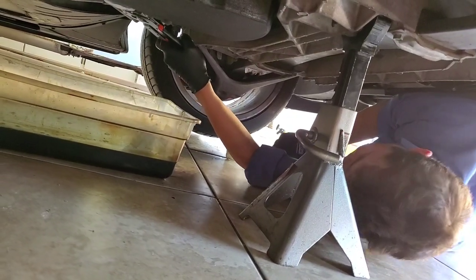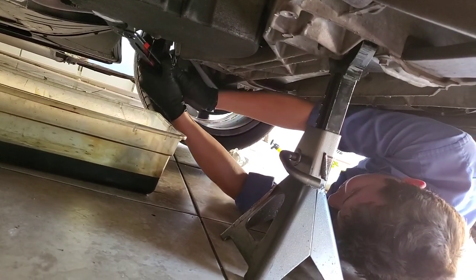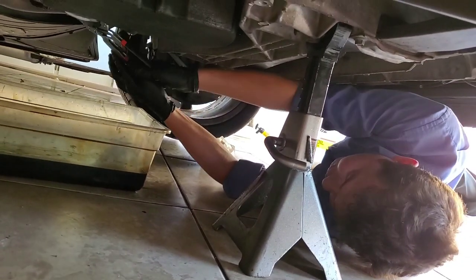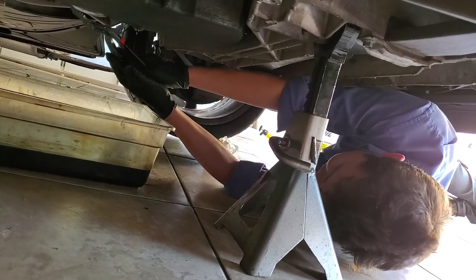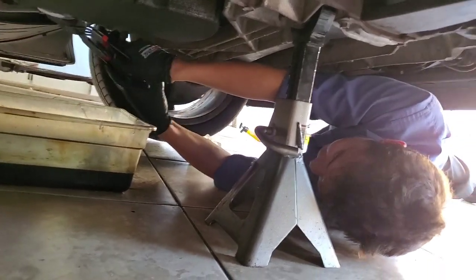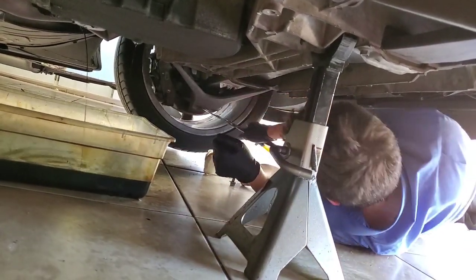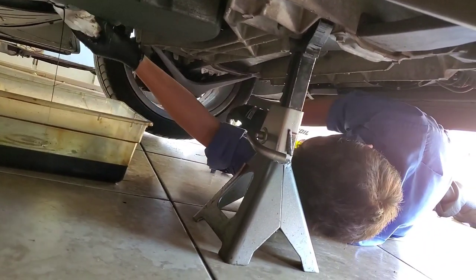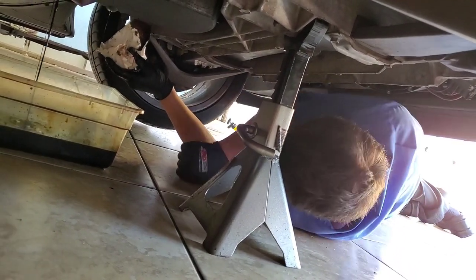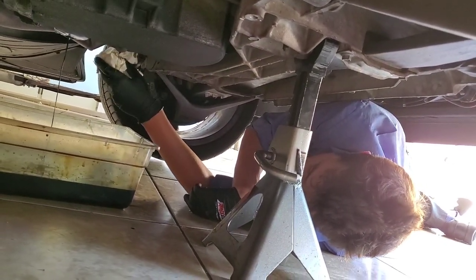She's a little bit of a stickler. There she is — this one's going to be like a little half turn. I wanted to thank a subscriber who said you can always drain the oil filters — get a little punch. I think this filter is so thin it already punched just with the wrench. Next time I've got to try that — put a little punch on it. Nice and loosey goosey. Now let her drain a little — you always want to use a little towel. It comes out quick. Just let her drain for a minute, and then the filter just threads right off. We're going to make sure the old silicone gasket came with it, and then it will be time to prep our new filter.